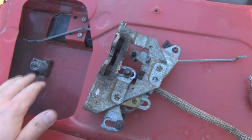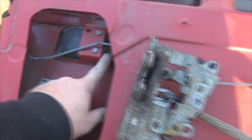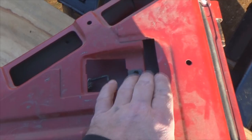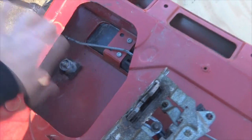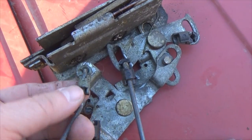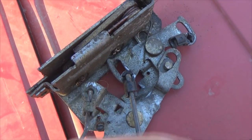The latch is out. The issues I was having: this rod right here kept hanging on the bottom of it, this rod right here kept hanging on the latch, and the long one that we left in got above this and didn't want to move. So I had to take the latch, pull it back forward this way to bring this rod end to tuck it underneath so I could maneuver it down to work it out. This right here is tucked underneath this flange so it's kind of a booger to get to with it still being in the door. To help with cleanup and lubricating the door latch, make sure you pop these clips off - they're just like all the rest of the clips. Snap back out of the way and the rod just looks up out of there. Be careful not to break them because on an old rig those things get brittle.